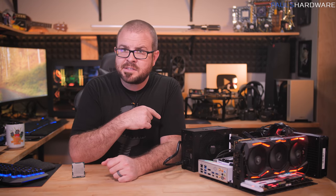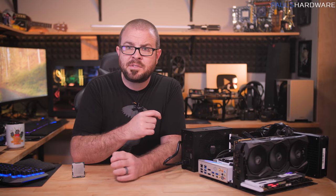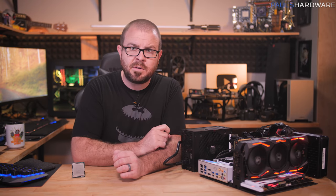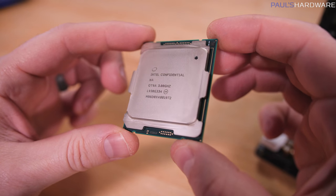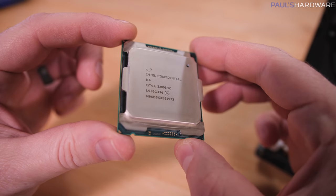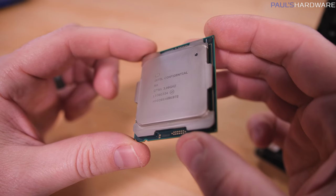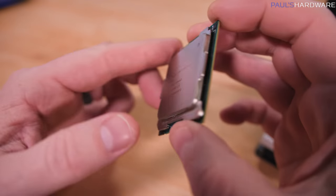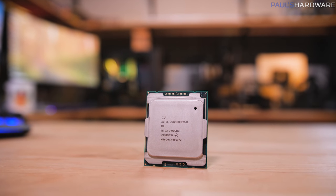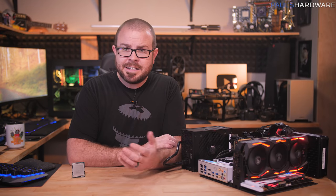AMD's Ryzen 3000 series CPUs, as well as the new Threadripper 3s, do have a couple nice features though. They're based on 7-nanometer lithography, whereas Intel is still working with 14-nanometer, and they feature native support for PCI Express Gen 4, as already mentioned. So Intel is coming into this launch with fewer cores, less connectivity, and a platform that's almost 2.5 years old now. But they have also slashed their prices. Finally, Intel is the budget option in today's video with the $1,000 10980XE. Like I said, this is weird. Let's take a look at my testbed setups though.